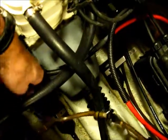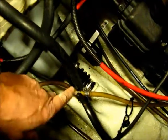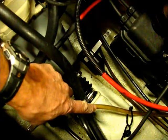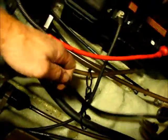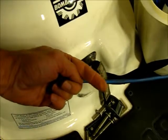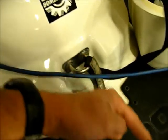Water's in this jacket. Additionally, it's running out the bottom of this exhaust manifold into this clear hose that I'm wiggling, into a T. The T then allows water to travel either to the back of the exhaust system where it just gets dumped out the back end, or it goes into this little black hose which goes to your tell-tale. Here's your tell-tale, where it will actually pee a stream — a lot of people call it the pee valve. It'll pee a stream out of here and it'll tell you if you have good water circulation.